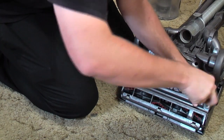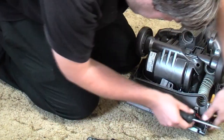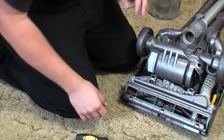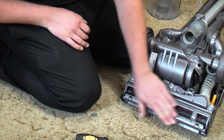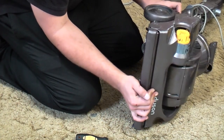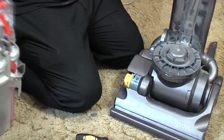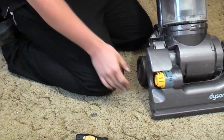I'm always a little bit wary of running a vacuum cleaner without the base because there's nothing to stop the brush roll moving and jamming itself — and it could certainly smash a window if it fires into one. So I'll do one last quick check to make sure you haven't jammed it up and then we'll have a longer run. Put the base plate on so we can have some suction and give it a test.